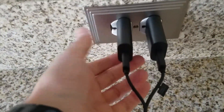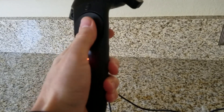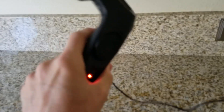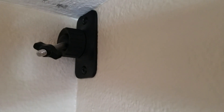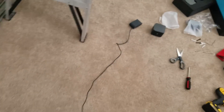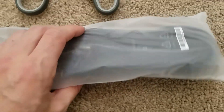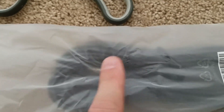It comes with two chargers with micro USB cables — two HTC chargers going into micro USB ports on the bottom of the controllers. It comes with these mounts as well, but you don't have to use them; you can use any sort of tripod mount. This is the adapter for the base station — that's the only plug the base station needs. The cord looks to be about 10 feet long. They also included a really long sync cable that you don't need if your base stations can see each other. If you've got something hanging from your ceiling like a ceiling fan, and the base stations can't see each other, then you're gonna have to run the sync cable from one base station to the other.